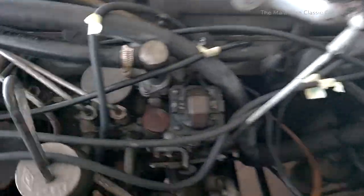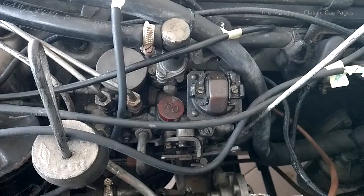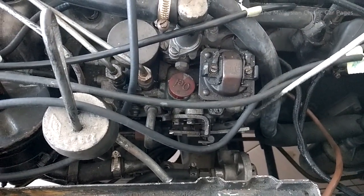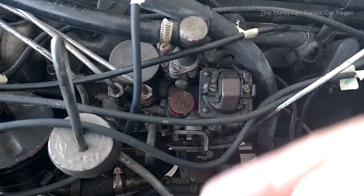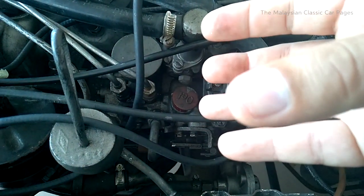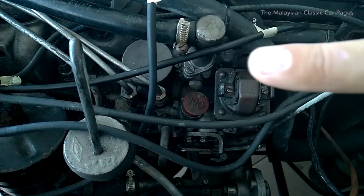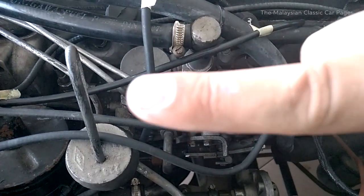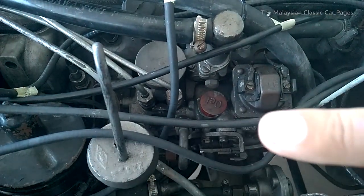This pump represents quite a few refinements over the Gullwing's pump. One of the major advances was in how it works out how to deliver fuel. Inside the pump there are two counterweights, and as the engine rotates the pump faster and faster, these two weights start moving apart. That motion is translated through a linkage that moves something called the rack. As this rack moves internally in the pump, it lets more fuel through the lines; as it moves back, it lets less fuel through.